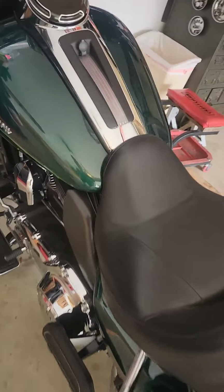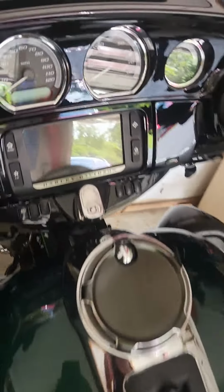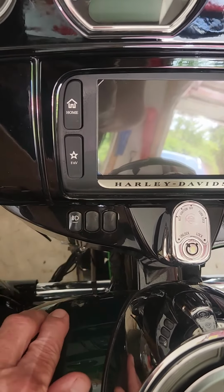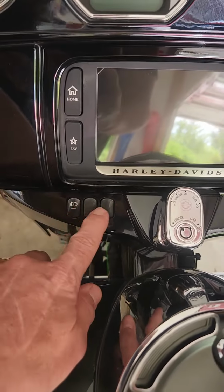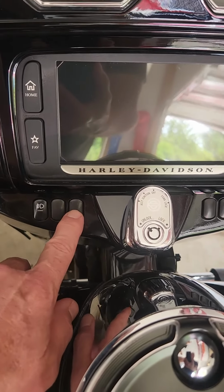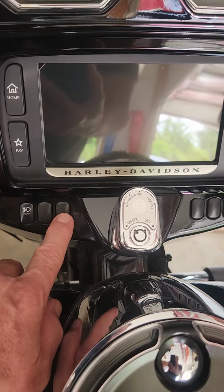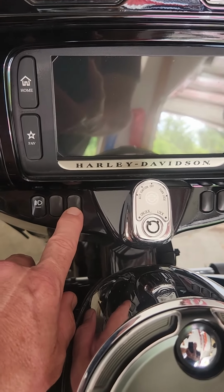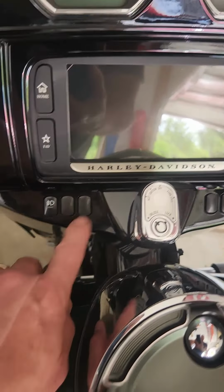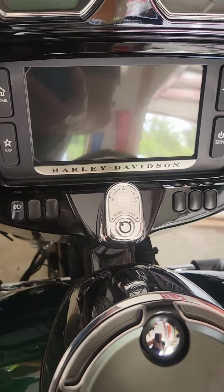The accessory port should be located right up here behind this guy, by where the main fuse is. The switches, you'll notice my bike already has a switch console here. I've got a set of lights, so I won't have to replace the whole bank. I'll just end up putting the new fan switch right here in this location. This is the accessory, I believe it's number 3 if you check the service manual. So that blank will come out, and I'll have a new one in there.